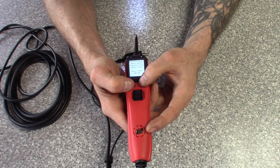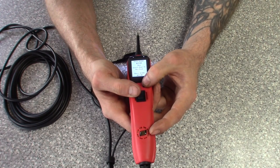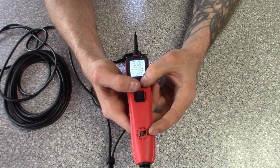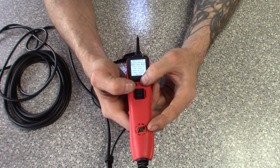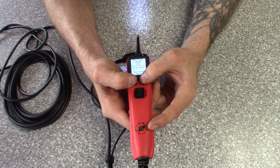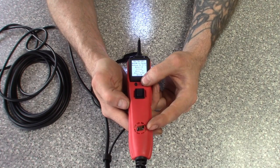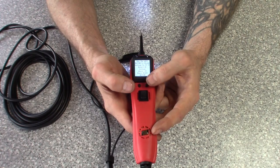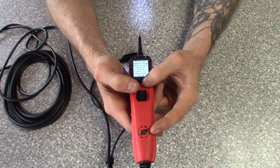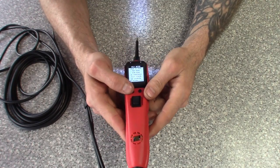In the diagnostics section you can go through the features step-by-step. For example: in peak-to-peak mode, it shows you how to check alternator ripple — start the vehicle, press the switch forward to set, and you can see alternator dropouts and diode issues. Another setting shows your charging voltage while the engine's running, right from the tip without even being at the alternator. Min peak gives you your voltage drop. The AC threshold section walks you through how to set it. It's still a little tricky navigating the buttons while filming backwards.